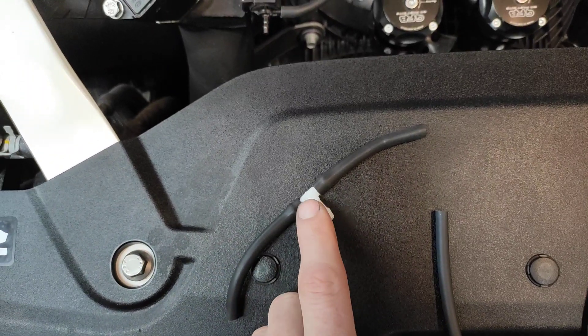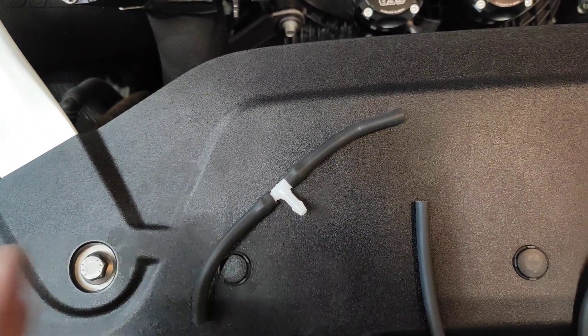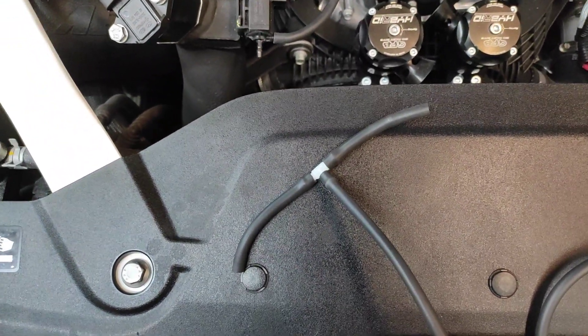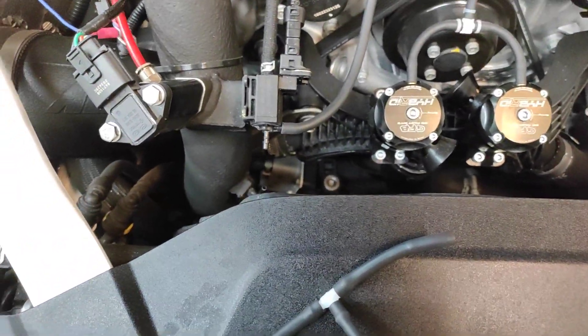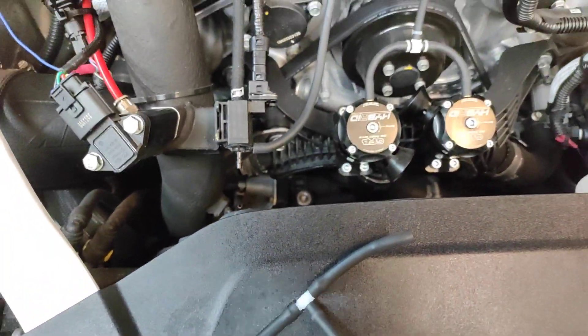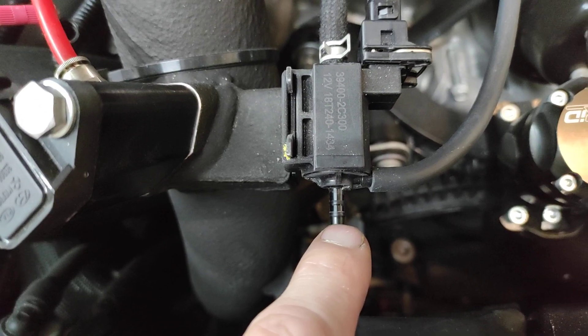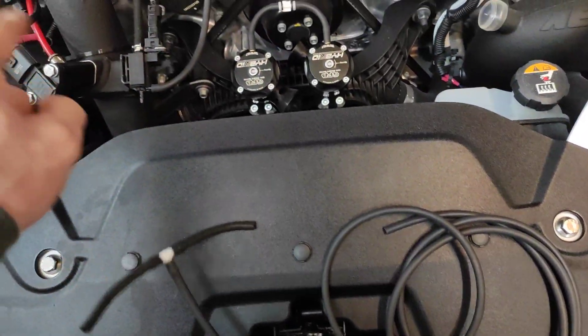Use a little bit of glass cleaner or something that will dissolve or evaporate on its own without leaving residue, and you can push the hoses onto the T fitting. Sometimes you can get them on without that, but it helps. I'd recommend putting your supply line on the T before installing it, so you're not reaching down and risk breaking off that plastic barb — it is your number one enemy when it comes to breaking because it's very thin plastic.